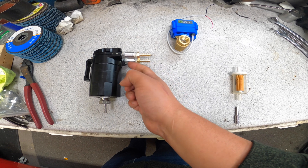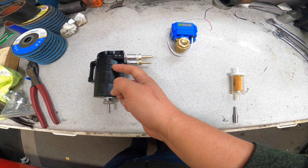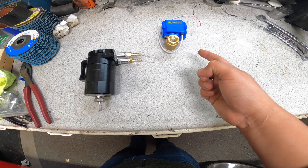This is an Amazon special oil catch can that I've modified for use as a charcoal canister. What's going to happen is the vapors come in, and then when the car is off, it'll force the vapors to go through the charcoal. Then it'll vent out, and I'm going to pipe this back towards the filter element of the throttle body.